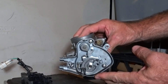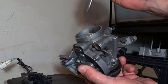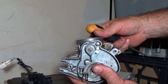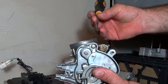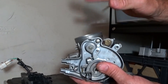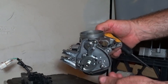Once you've done that, the bike can no longer maintain its own idle, so what you'll need to do is adjust this brass air screw. It's a bypass from the top — fresh clean air from the air cleaner down to below the primary throttle. Allowing more air in by winding this screw out will raise the idle speed; obviously turning it in will slow the engine idle. You should be able to find a happy idle speed where at warm idle it's not too fast, but on a cold start it will just maintain idle. On my own Husqvarna 449 I've found that something like 2000 to 2100 RPM is a perfect idle speed. They don't have a whole lot of flywheel weight on that model, so they need a fairly quick idle speed — much less than that and they're fairly chattery and noisy.